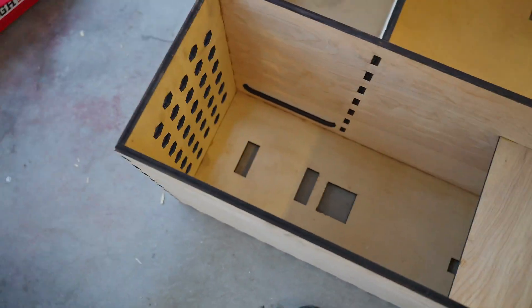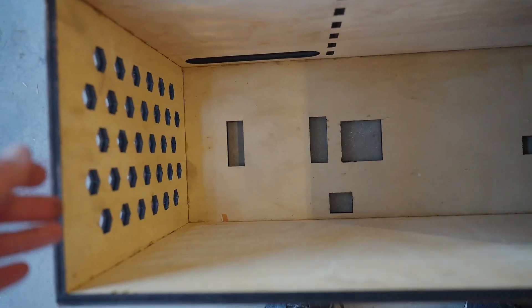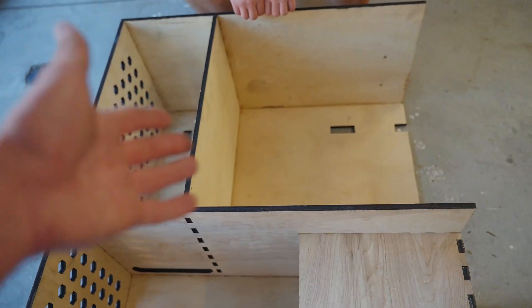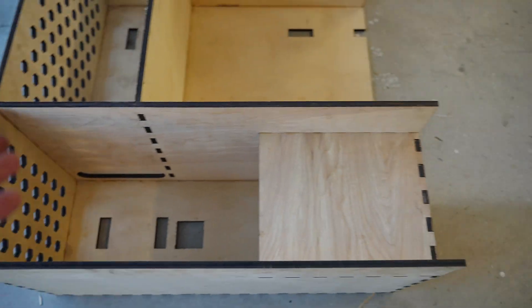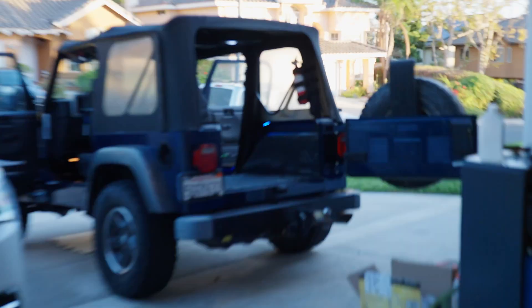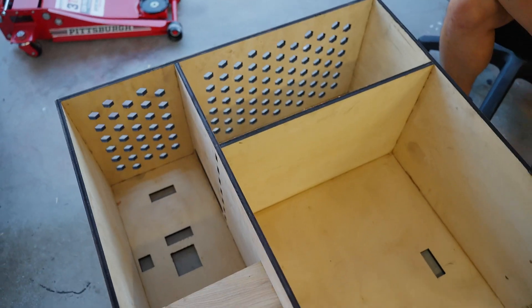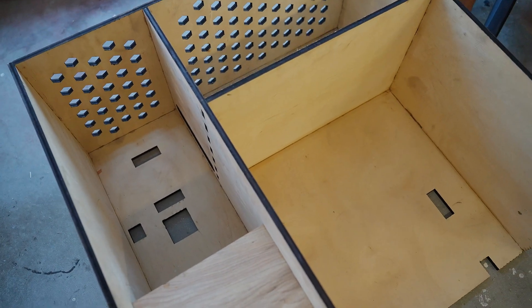We'll be able to fit it here and we're going to do three-quarter-inch plywood for the top. All these different holes are for different power that comes through. The horizontal and vertical holes in the front and same on that side are for tie-down hooks built into the Jeep — we needed to cut out space for them. We just cut these two holes on this side and that lines up with two holes on the side of the Jeep. Next we're going to put in a bunch of holes on the bottom, measure them out, drill, and make sure it fits perfectly.